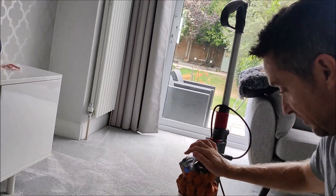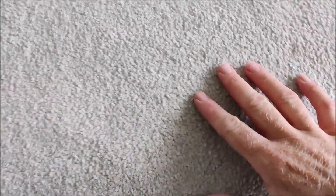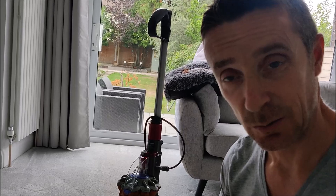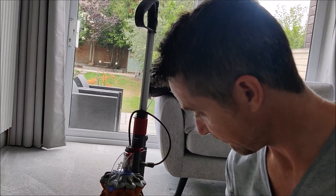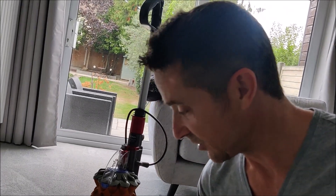Hello guys, Craig from Fix It Fellows. I'm inside the house trying to do the hoovering with this Dyson — the multi-floor ball animal. However, this medium pile carpet — this hoover cannot cope. It sucks itself to the floor and the moment the motor starts straining, there's built-in circuitry that shuts the motor off should it be under too much strain.